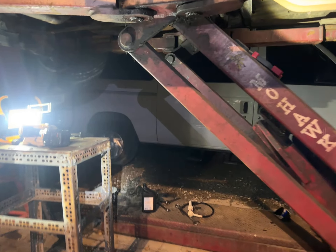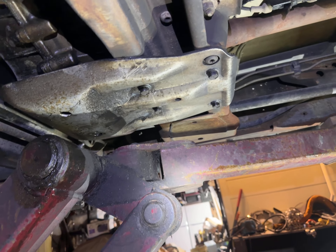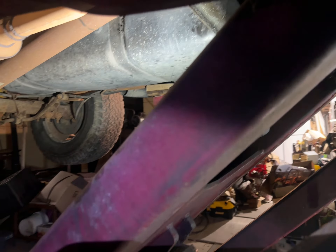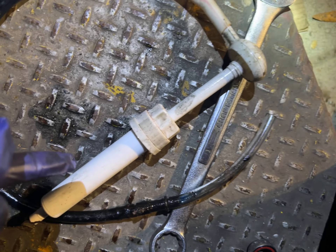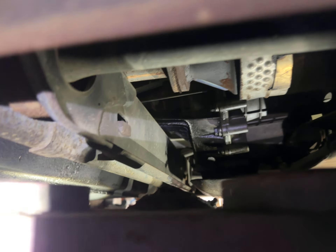The fluid that comes out looks kind of bluish — it's AutoTrack 2 fluid. It's supposed to be about two quarts but buy three, because that's just how it is. They're about $11.99 each, so buy three of them. Adding the fluid on this particular model was really difficult. You see that gap there — we had to extend the hose on the pump tool, running it all the way from the rear over to there. It's definitely a two-person job, with somebody reloading while you hold the hose in.